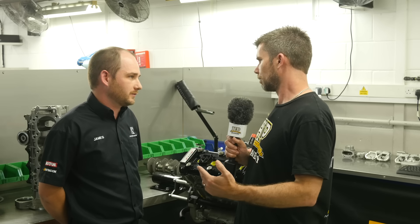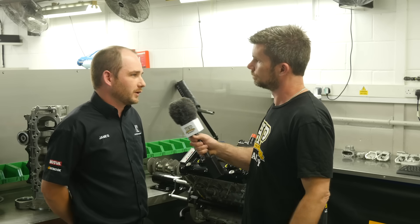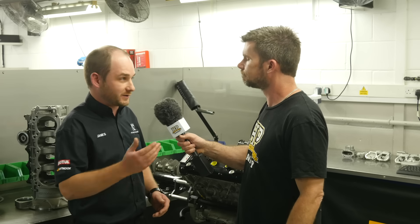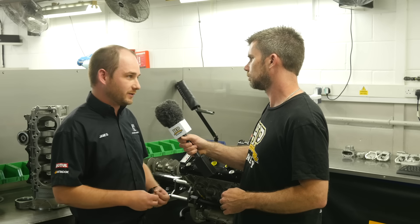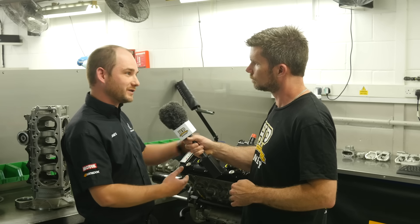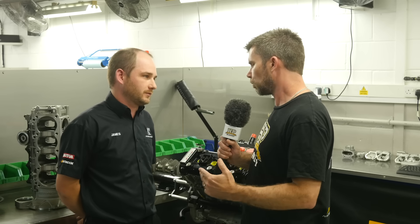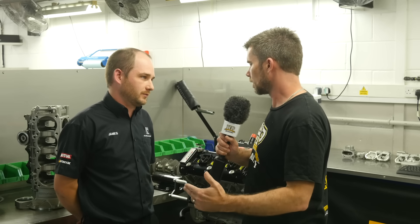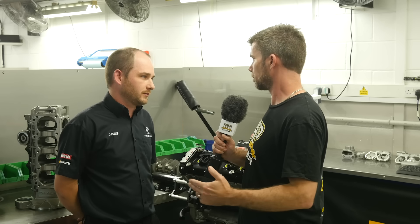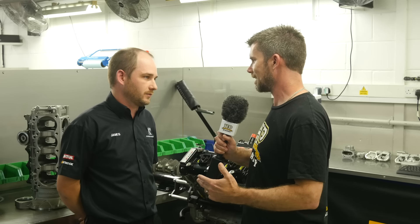When you go from the relatively natural 90-degree angle for a V8 to 72 degrees, what problems does this give you? The first problem is the firing order. In a conventional 90-degree V8 you have a very easy 90, 90, 90 degrees and so on. But being a 72-degree V you have a 180-degree firing order on one bank but then a 72-degree firing after the adjacent cylinder. So in a normal V8 with a 90-degree bank angle, essentially one piston reaches top dead centre every 90 degrees of rotation — a nice even torque distribution. But in the odd-fire 72-degree V8, that's not the case.